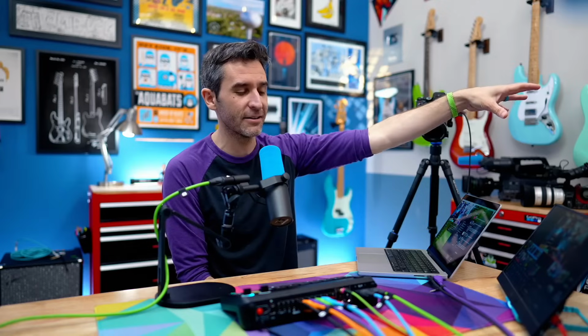The white noise thing is something that I've noticed can happen, and this happens a lot on my Interview Pro. If you have the noise gate turned on, it's constant and adaptive. With the Interview Pro, I have the noise gate on and I'm talking into it, and it sounds great. If I set the mic down and leave and come back, and it's been sitting there picking up room noise, then when I bring it back it's almost been readjusted or recalibrated itself. So maybe diving into your settings and turning off some of the processing, like the noise gate, or adjusting it, might help with that white noise. If anyone else has suggestions for that, that would be super appreciated, because maybe you could help me too.